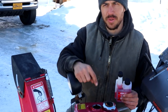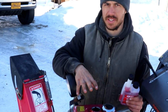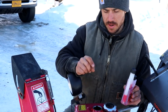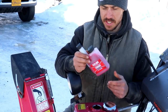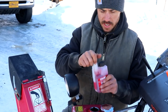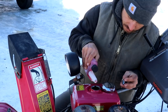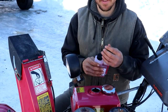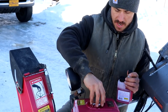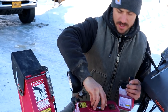There are a lot of things you can do as far as gas in these things when storing them for the season. We're not sure if we're going to be storing this for the season — chances are we're going to have to use it again — so I'm just going to put some stabilizer in for now. We run premium gas in this, and the stabilizer is basically going to keep the gas fresh while we're not using it. Then you just want to run it for a minute or so to get the stabilizer running through the carburetor and into the engine.